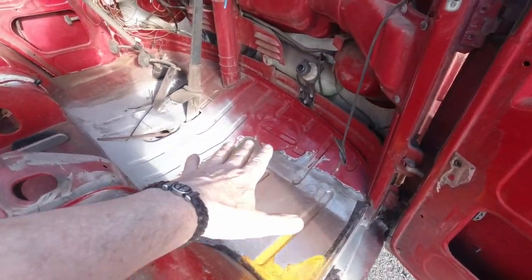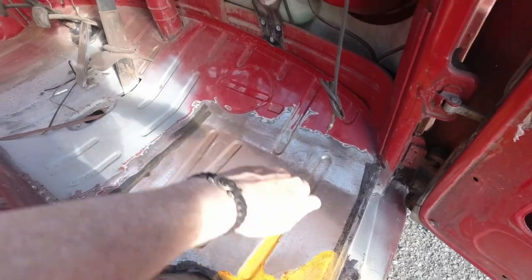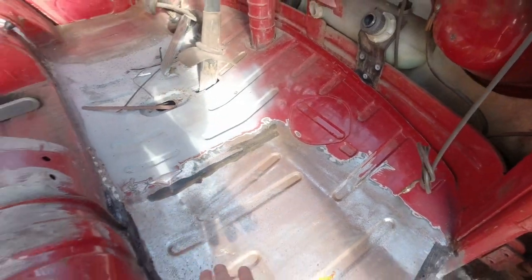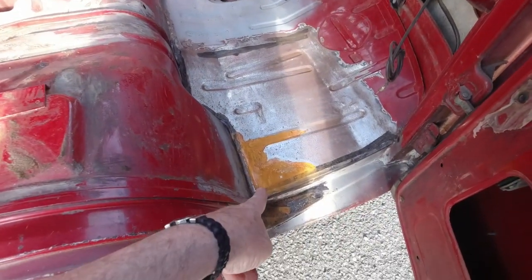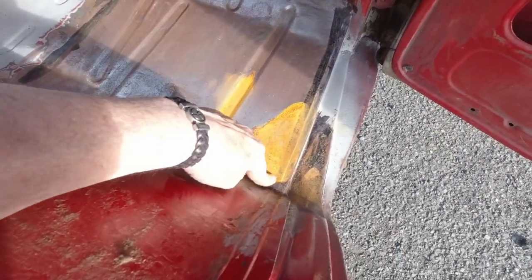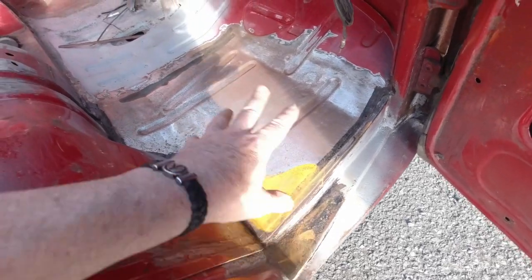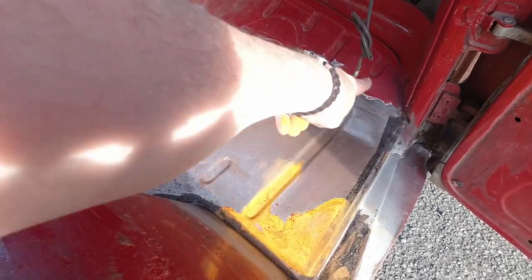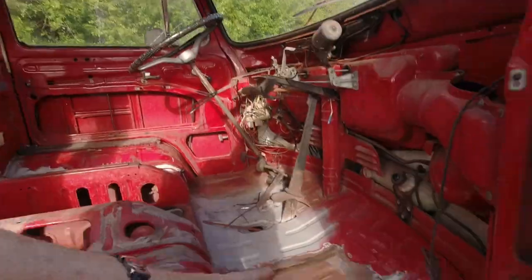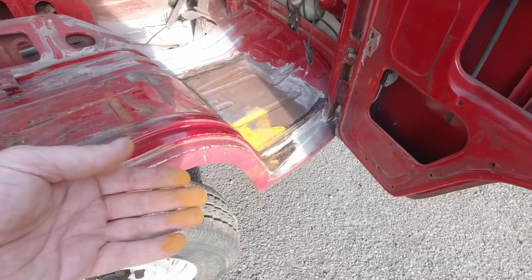Okay, so you go in here to the footwell area, okay? And it could be rusted out. You can lift the mats and check to make sure it's okay underneath, yeah? This is a repair piece that's been put in and now it's going back in to get finished off. It is evident from this stain, which is just water sitting on top, that has to be checked out now, because this area I've replaced, a whole new corner on the step here, and this footwell was done and put in, and I'm going to have to check to see, because this was sealed and it shouldn't have leaked. Basically, it's just on the top, and I'm going to get that off as soon as this vid is finished.